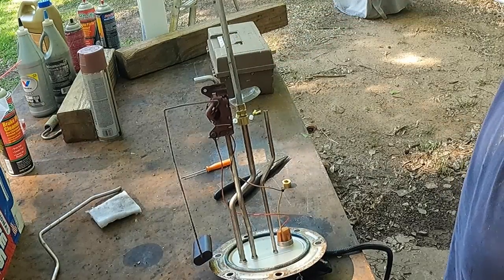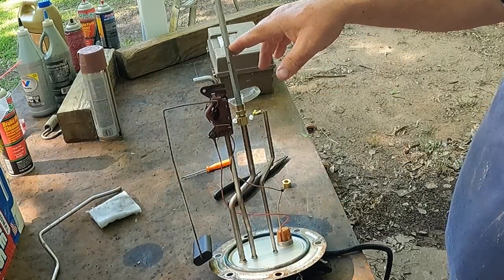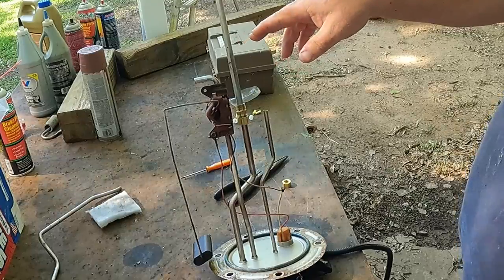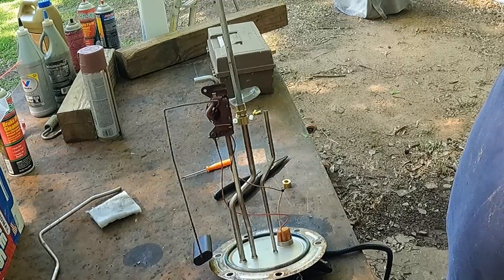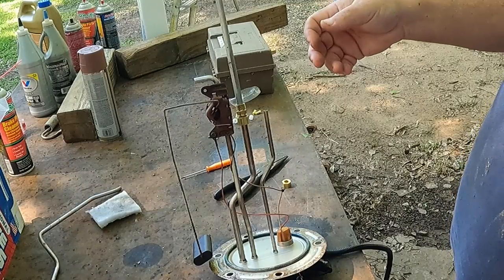Now, if you wanna put a fuel filter, you could see if you could find a sock filter that would fit on a 3/8, which I may end up doing on this truck. But also, another good thing that I've done on my other 450 is I'm getting ready to mount a fuel filter on the inside of the C-channel, like a 10 micron with a water drip trap, so that it can be drained.